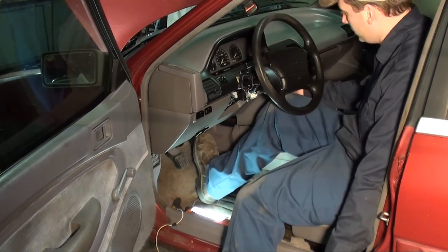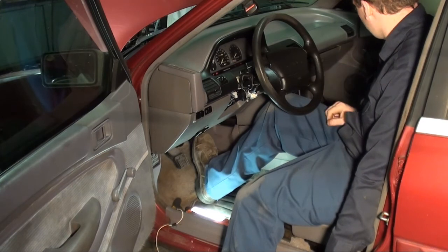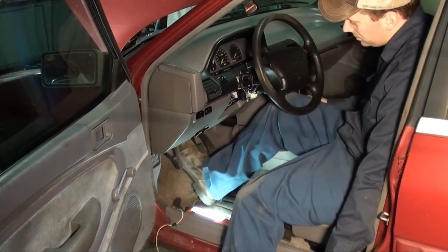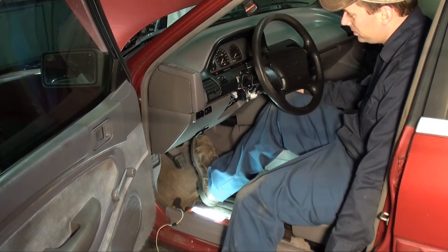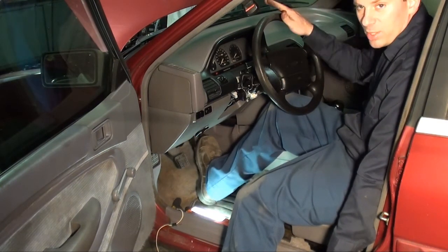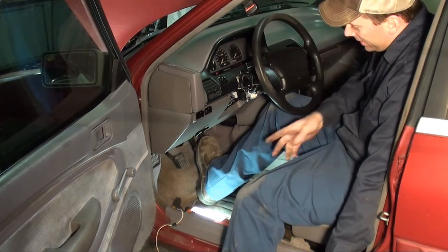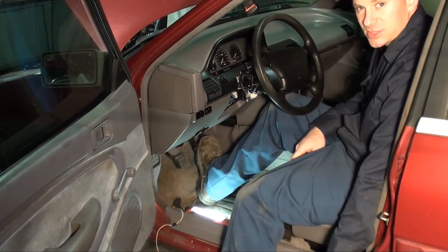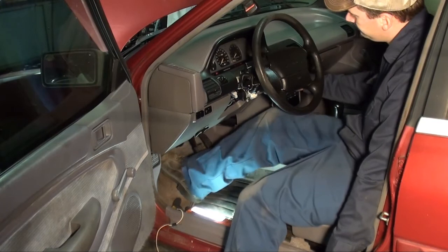Install the tape. Looks like I have all my accessories. The radio came on. So everything's lit up. Looks good. When I hit start without pushing the clutch in, it doesn't try to crank. I got everything plugged back in. I got the starter control wire plugged back in. I got the safety switch plugged back in. So when I push down on this clutch, it should start, as long as we fix the problem. Let's try it.